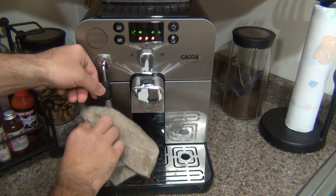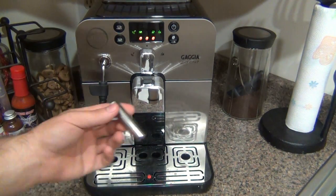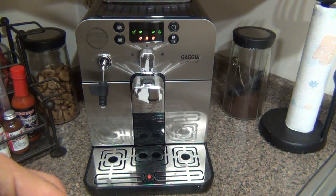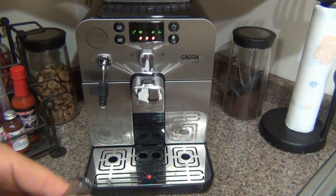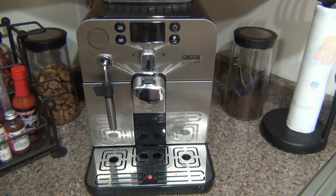Switch to steam, let it purge a little hot water or steam, then shut it off and wipe down the entire steam wand with a clean cloth. You want to do this each time — you can pull the whole tip off to clean it, but at minimum you don't want old dried milk sitting on there. That's pretty much it. I'll put links in the description to this specific machine and to Whole Latte Love's YouTube page, which is extremely informative. Thanks for watching — if you have any questions feel free to ask, and I'll see you soon.